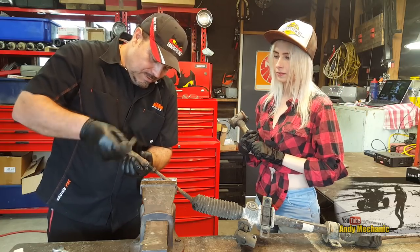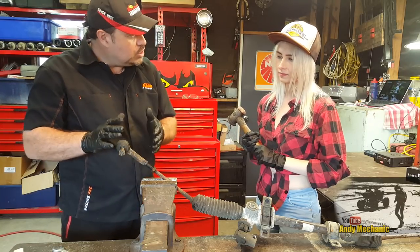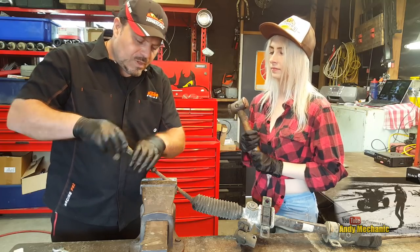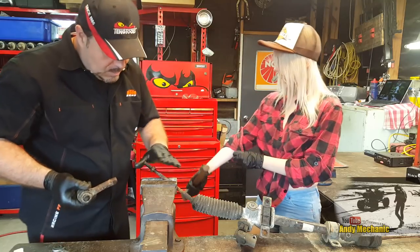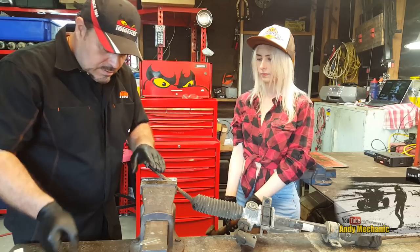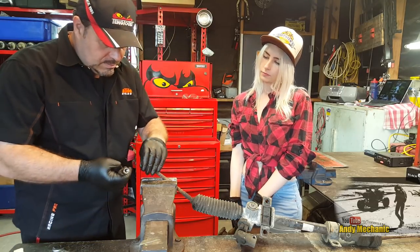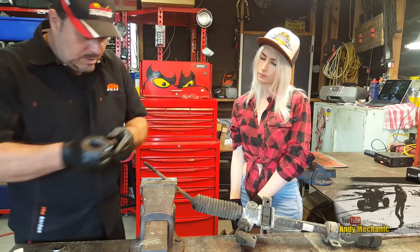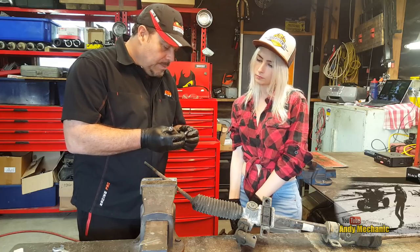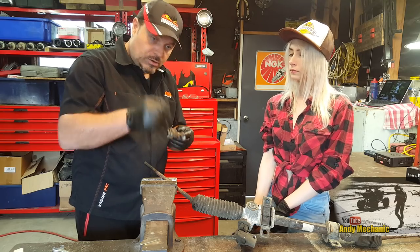Right, so now... Jeez. And the threads are so long, so you can make adjustments to the steering. You get your car, get your steering, the tracking done, you can. This is basically the things that they adjust. One of the things that they adjust. Okay. Sit that down there. One of the things that these can fail on when you go for a warrant is there can be too much play in that ball joint. And I did a video on a Yamaha Viking that had been in an accident, and one of these had got really badly damaged. So that's already on a video.